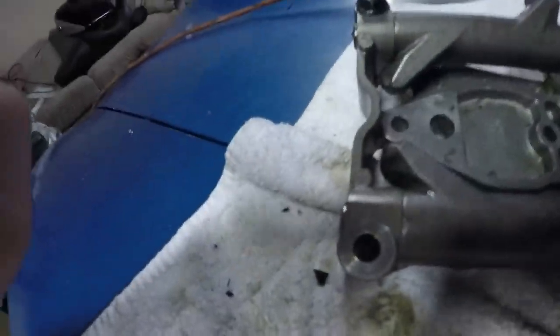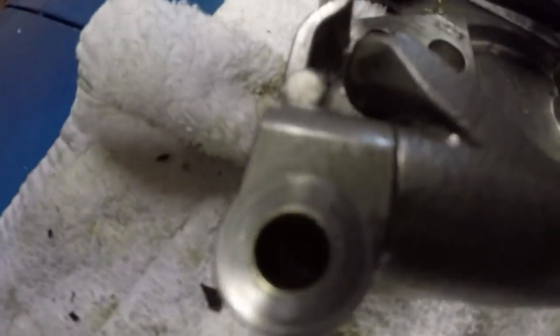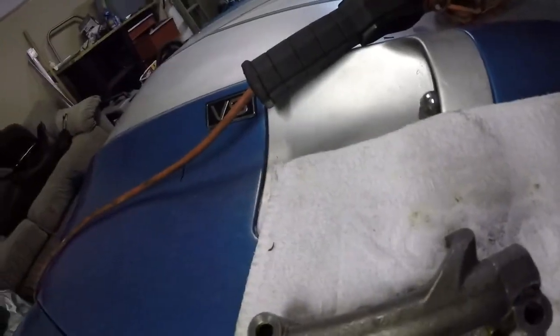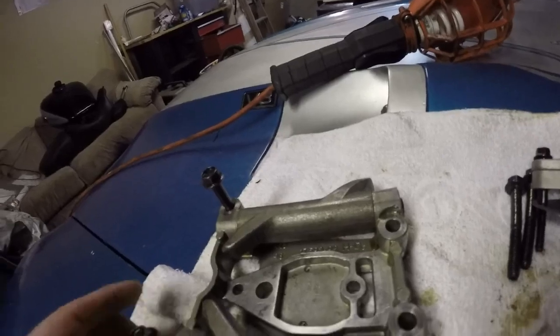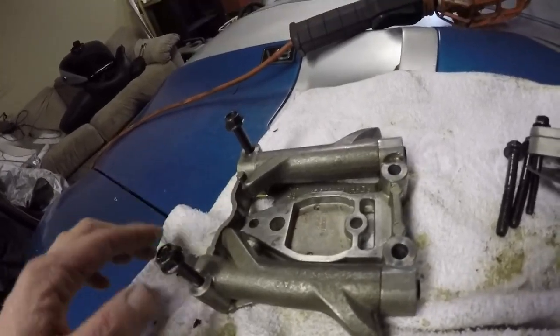What I want to show you is when you get everything together it's gonna look like that. If you look real close, you can see the liner goes in there to stop these shafts from rocking. I totally get how that works — it's not anything out of this world. The reason you want to take the rockers off the engine to do this is because these bolts aren't going to fit in there loose like they did from the factory, and so this whole thing is going to center up based on these new inserts.